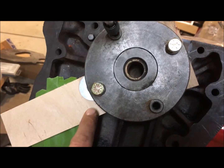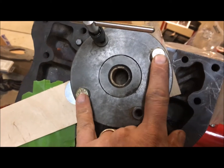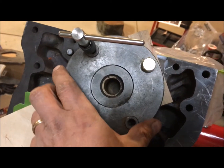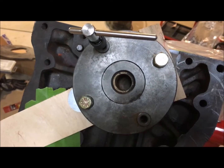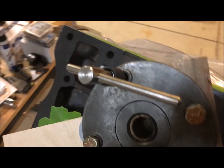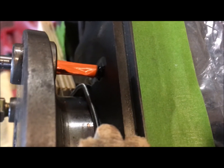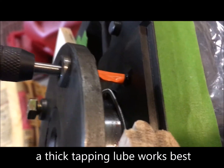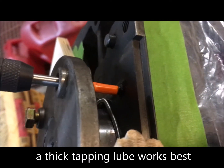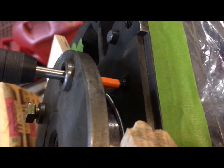The wood keeps it from damaging the threads on the bolts or the engine block itself. I just have these really tight against the block, basically locking the whole thing in place. Then when I drill and tap each one, it goes really well. Just make sure to have a really good lube. I've got tape on my tap and I'm backing it off right now — it's going really well.